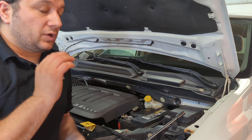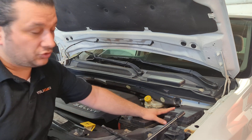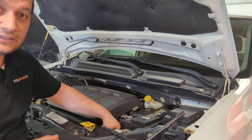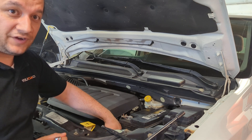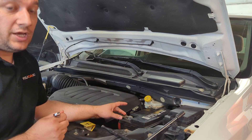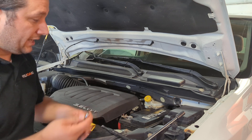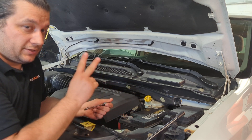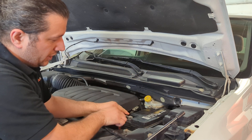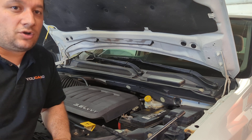What could be an even bigger headache: if you have power to the vehicle and you accidentally drop a terminal so it touches the frame, you've just shorted it. The smallest damage from that is probably a blown fuse, but you can also fry a control unit, ruin your ignition, or damage your ECU. Similarly, if you're keeping power connected and you're using a longer wrench to tighten the terminal and accidentally touch the wrong spot, you can cause a lot of damage.